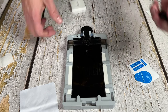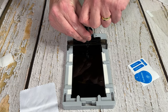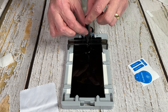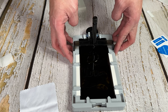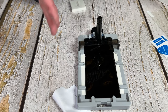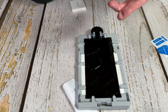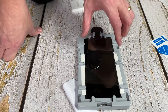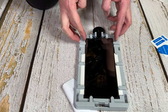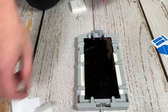Take your little ice cream spoon and fit it in. Now grab your glue, remove the pink part from the top, place it inside the hole, and when you're ready twist to release the glue. Make sure the phone is on a nice even, flat surface. Give the glue a quick tap to make sure everything's out, then place the dispenser aside. Peel off the backing paper from the screen protector, place it into the gap, lean it on, then push down and let it go and do its thing — the glue will take a while to spread, so just let it.